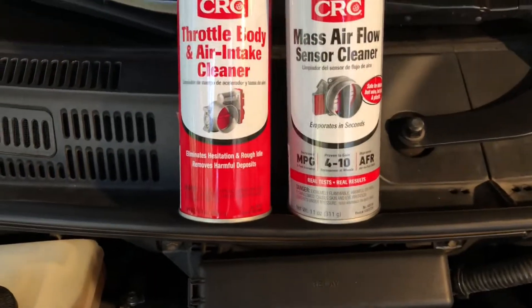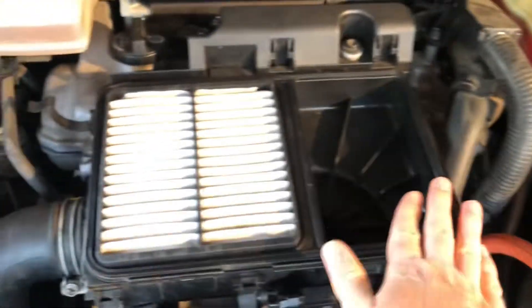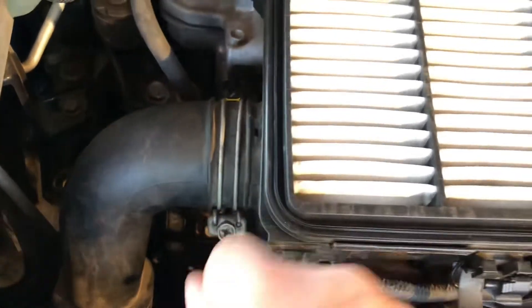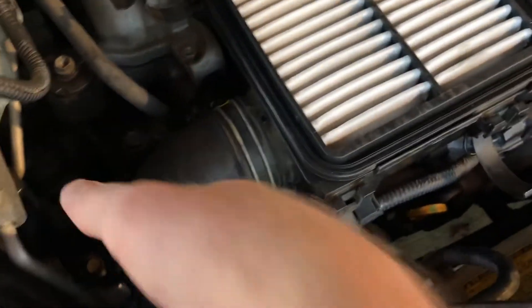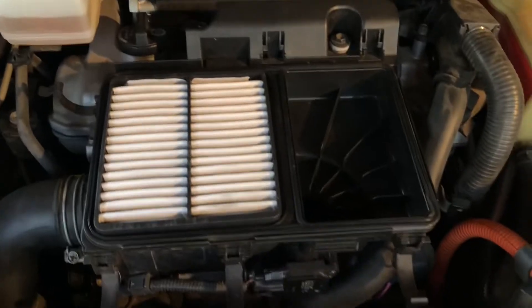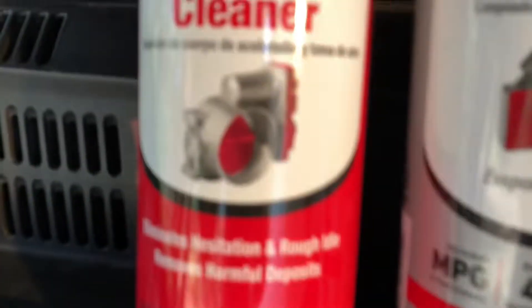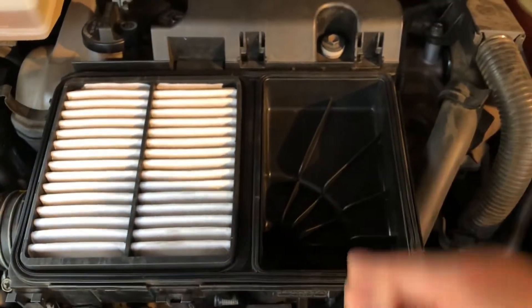Throttle body cleaning is a little bit different. Now you have to take this whole thing off. For the throttle body cleaning, take this out and put it somewhere safe — don't mess that up. Then you're going to need to take this hose off, which isn't that bad actually. Take a screwdriver, unscrew it, and then very firmly but gently pull straight back. This was covered in dust and was a lot of trouble — this is the second owner of this car and I don't think they cleaned this for a while. You take this off, and then there might be a final screw on there — watch those videos, they'll tell you. You just pull this straight up, and then you'll see a little circle thing. It'll be gold underneath it, and you can twist it open as you'll see in the other videos.